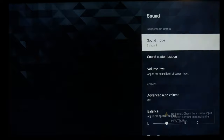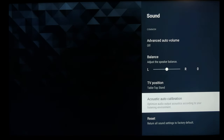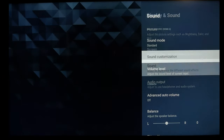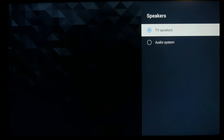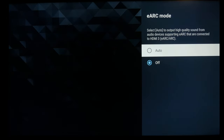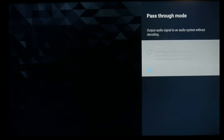Sound is for your built-in TV speaker sound, and it's where you can do the acoustic auto-calibration with the remote, or you can adjust the settings to your own personal preference. Under Audio Output, that's where you change to a receiver or soundbar system. And then if you're using eARC, you need to come down to eARC mode and put that on Auto, and you should also go to the bottom and turn pass-through mode to on or Auto.